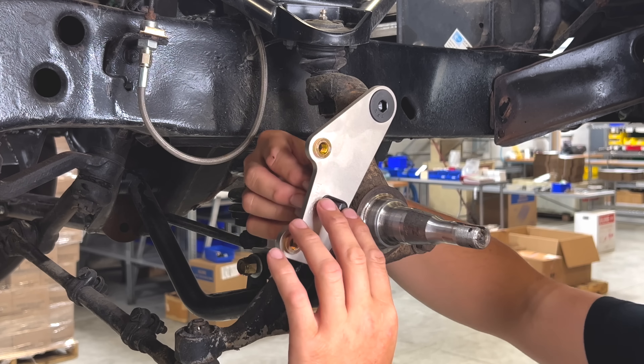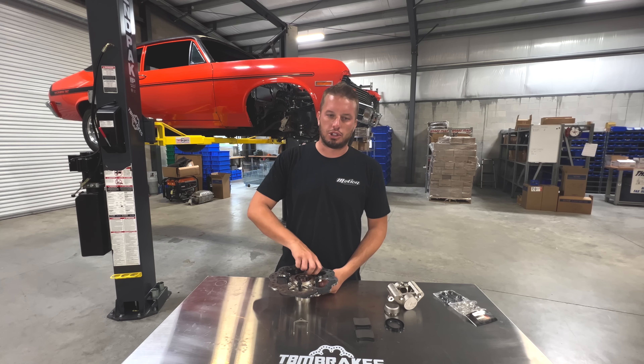Because you're replacing the actual hub in this kit, it comes with 1/2-20 studs. They simply screw into the back of the hub — they're 12-point so they're easy to torque. Put some red Loctite on them before finishing. These get torqued to 60 foot-pounds, which is easier to do on the vehicle where you have a steady situation. Finally, install the dust seal in the back of the hub before putting it on the car, then slide the hub right over the pin and install the front bearing.